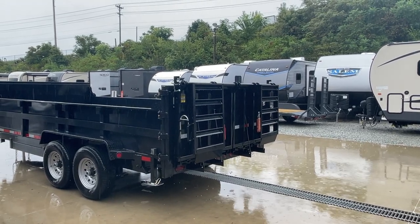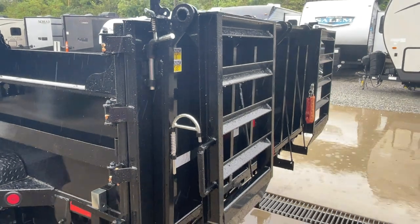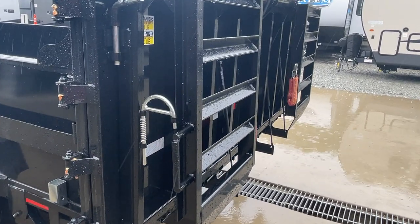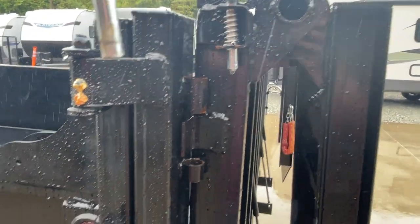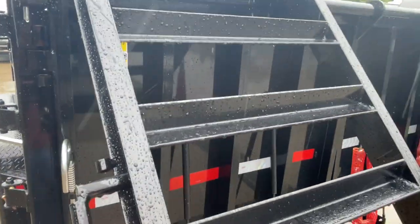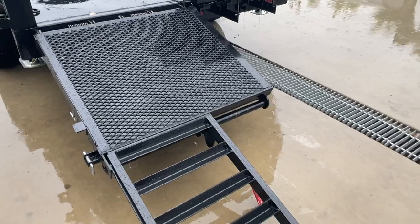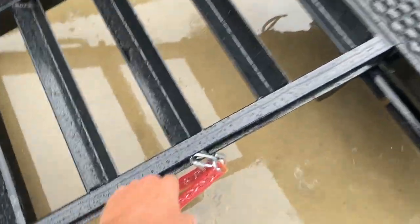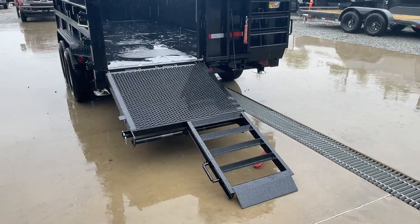Generally you'd want to have two hands for this, but I'll show you today that you can actually do it with one hand. There are some extra hinges on the gate as standard equipment. While this will act as a ramp, it will still side-hinge and open up like a traditional barn door, which is what a lot of folks will use. First, you've got a safety pin — slide that past and pull the pin out. We've got a retainer here, so now it's opened up. We just undo the release because it is a bi-fold, and simply pull it out. It does have a gas shock on it, which makes this pretty doable to use with one hand. This particular extension ramp on the bar will slide all the way — if you want to slide this and the other side both together, you can do that.